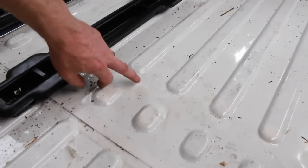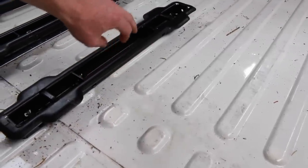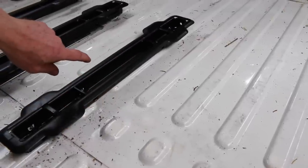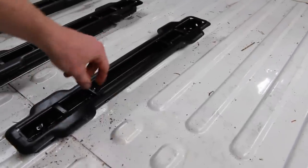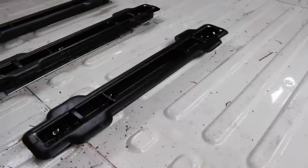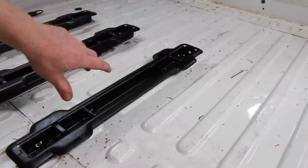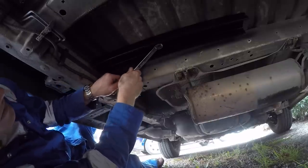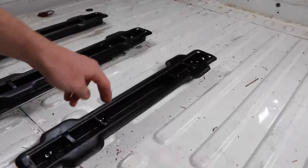I mean, this is so thin, I don't know what it is, a mil and a half or so. So you fly straight through that stuff. But then of course we needed the steel underneath to be exactly right. So what we ended up doing is I held it up from underneath, put a wax crayon through the hole to mark it. Now, rather than mark all three in that fairly imprecise way, we marked to the center one, bolted the steel up as a dry fit. Then we used the small drill bit to get it exactly right in the middle.